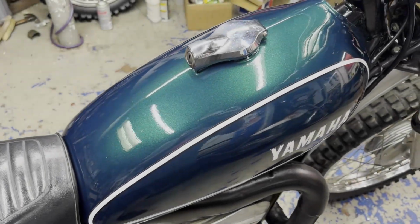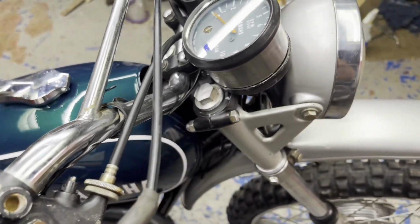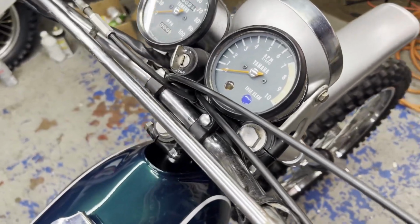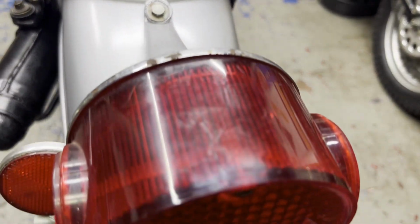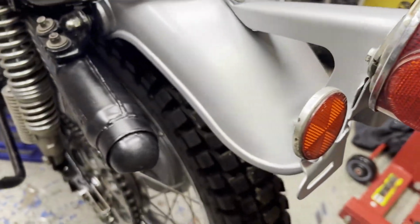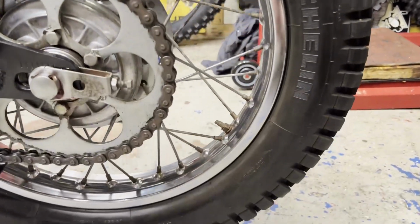All right, guys, thanks for watching. That's gonna wrap up this video. I'm gonna get that jetting sorted out. I'm gonna tear the carburetor apart, take it for another ride. I'll be sure to update you guys on how that worked, just because it ran great up until about half throttle, and whenever I go full throttle, it seemed to go worse.